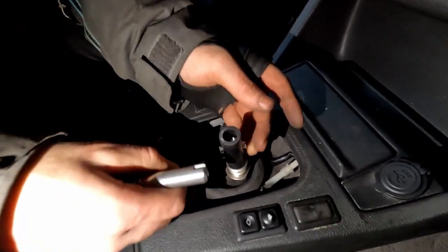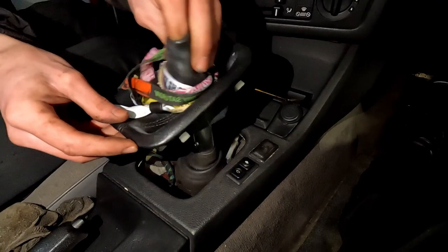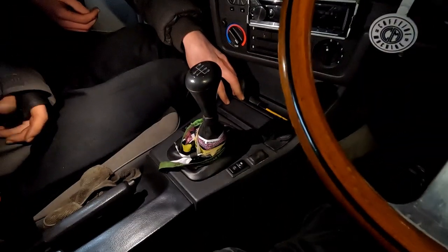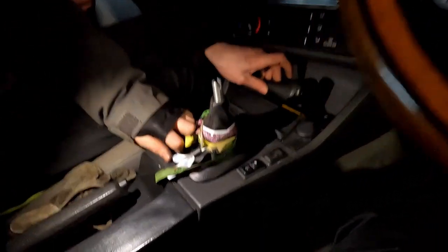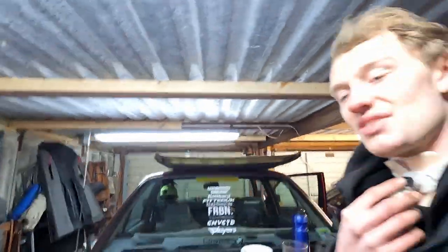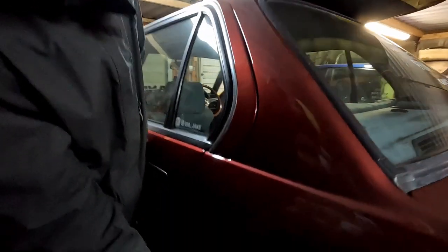Here we have the boys trying to figure out how the gear stick attaches - we managed to get that rubber boot back on. That is the short shifter installed. We managed to lower it down a little bit. It's a bit tall and we've got a Nardi gear knob on it - I just need to tap the threads onto it. It is a much better shift - the throw is only that much now. It feels nice and notchy and I'm happy with that. The fiberglass Joe's done has gone really well, there's real thickness to it.